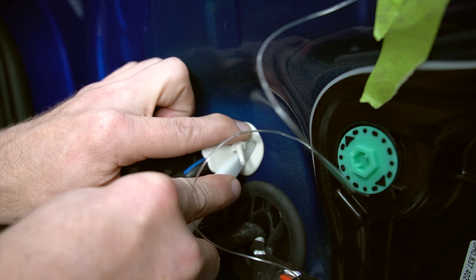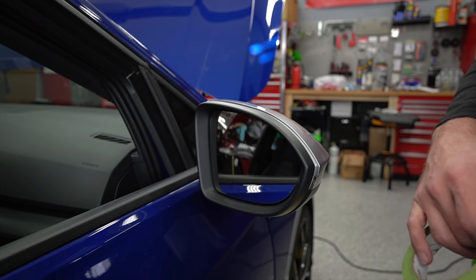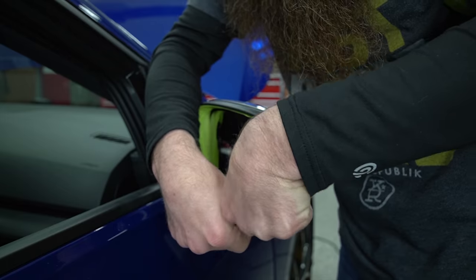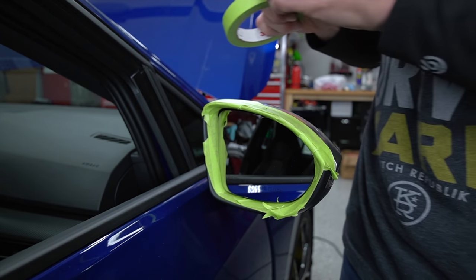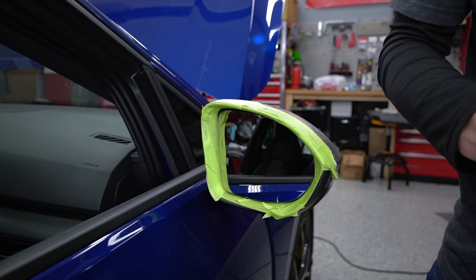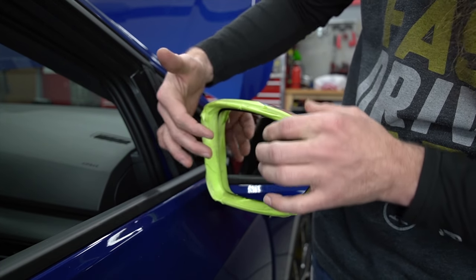Now we can push our little rubber grommet back into the door. Now it is time for the worst part of this entire job — taking off the mirror glass. This always makes me a little uncomfortable ever since I broke two on a Beetle many years ago. We're gonna throw some tape kind of in the housing so we don't scuff it up, even though we're not gonna be using this housing. Remember, this mirror also has wiring attached to it for the heater, so you can't just yank it out with all your muscle. Got to be gentle and careful — but also pry like there is no tomorrow. There's actually a special tool that's supposed to go up between this piece and the glass and pop it out.